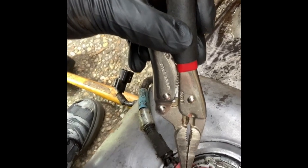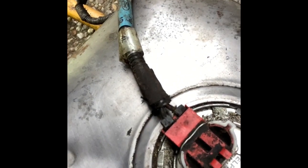When I was removing the gas tank, the little plug that goes on top of the fuel pump from the harness snapped a tab off that holds it in place. So I grabbed some safety wire and safety wired the plug back on — this is a huge thing we did in the Navy. I didn't have the right safety wire tool, but I made it work. For you air framer types and mechs out there, don't judge — this is decent. The wire comes up around and underneath the little tab on the side, then I spun it around. Safety wired the plug on because the tab broke off.